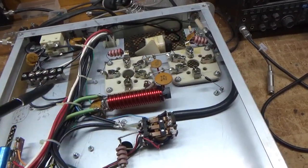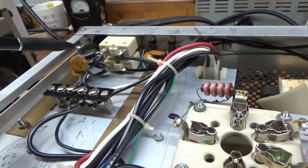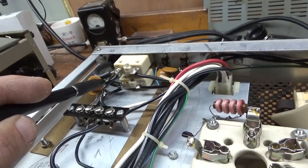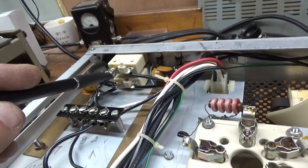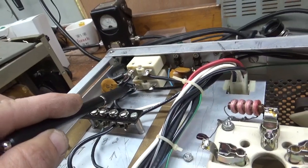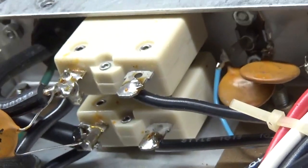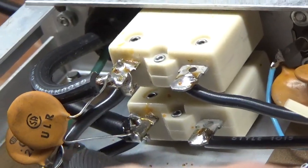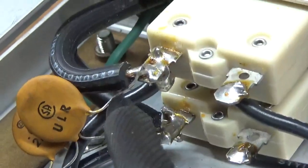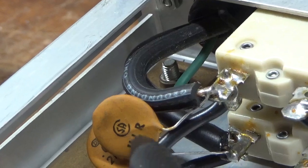The right way - not with craft wire. I'm going to unsolder these and flip the breaker over. This is rubbing right up against the cabinet, the shell. And look at this - this has one side of the 120 on it. Well if it's wired for 220, one side of the 120 is on the other side, and for 110 it has the neutral and the hot. So look at the lead here - that's the hot lead at line potential, and you have the lead on the cap that's at ground potential over the other cap. Look how close they are. I can't even fit the tip of my pen in between them. So you have the line connected to these two, and this one's at ground potential - they're almost touching. So I'll unsolder those and I'll put some heat shrink on them so you don't have to worry about them ever shorting.